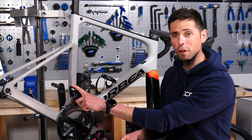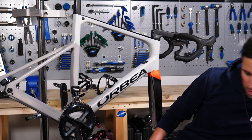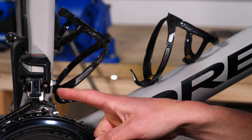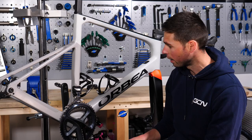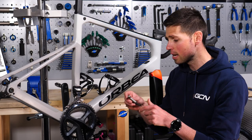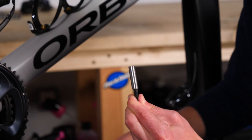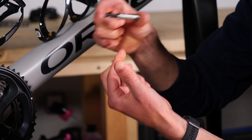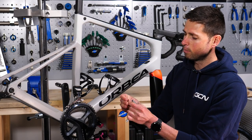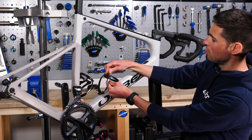Before I take my front derailleur off, a couple of easy parts to remove first. I can take my spares tool container off and tuck that to one side, and then also remove the bottle cages — two simple components to remove that will also make it easier to gain access to the bolt for the front derailleur. A handy little feature of this mini ratchet set is that the chain tool piece can be removed and used as an extender for the ratchet, giving nice access to undo the bottle cage bolts.